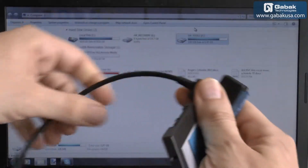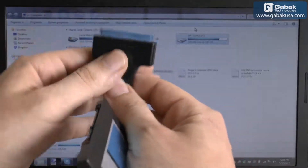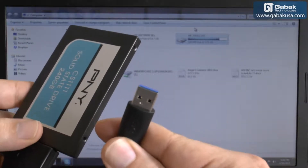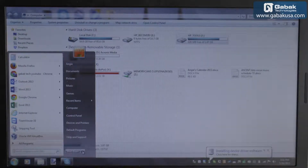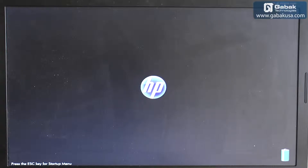We are going to use this hard drive to make the clone, so we will have more space. We are going to use this USB adapter — it's 3.0 because it's blue — and connect it here, then connect to the USB port. Now we boot up with the CD. In this case we have a 120GB Kingston drive and we are going to upgrade it to 240GB.